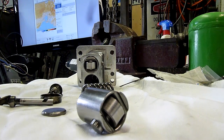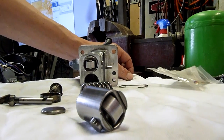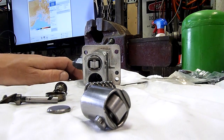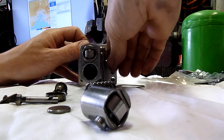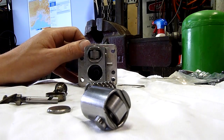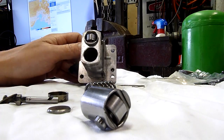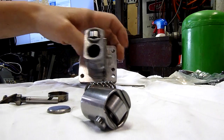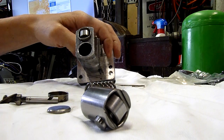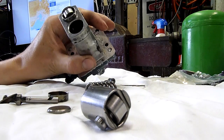So the main thing is a little slot down inside the bottom there, and we've got to get this little key lined up with it, because this is connected to your fuel shut-off — it rotates those pins. Drop them down inside.